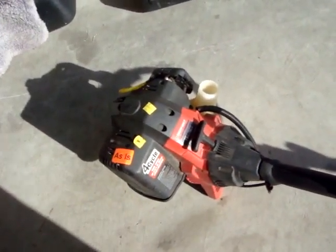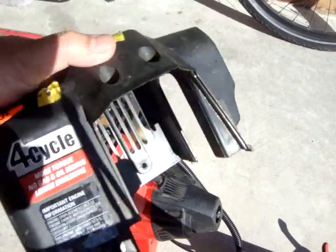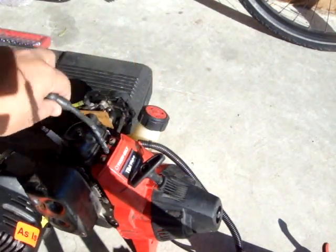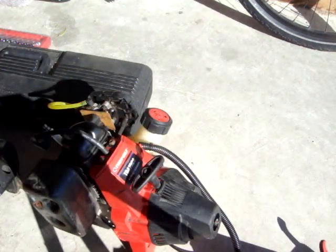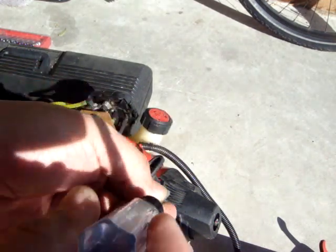So what I'm going to do is take it apart and find out exactly what's wrong with it. I now have it apart. I've taken off the plastic shroud that goes up over here, and I'm going to have a look at the valves real quickly. I need to get this front plastic shrouding off so I can get at the magneto, look at the wiring, and make sure it's able to generate a spark. My next step is to go in with a T15 Torx screwdriver.